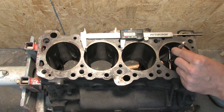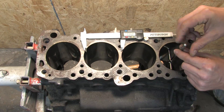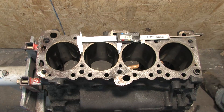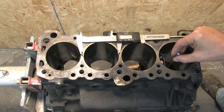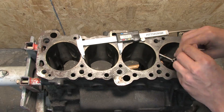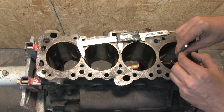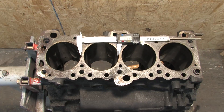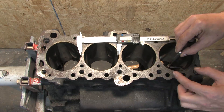Now measure halfway through the stroke to test the wear from the piston skirt's thrust angles. Piston slap occurs during articulation on the wrist pin — the looser and sloppier the pistons are in the bore, the more this wears out of round. If the measurement differs from the top measurements, that's called taper, because the cylinder walls aren't perfectly parallel. If that gets out of hand, the rings won't seal well and your engine makes less compression and consumes more oil.